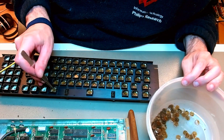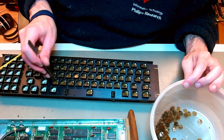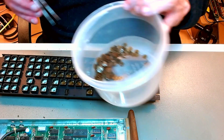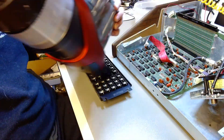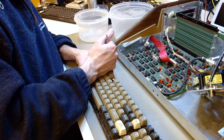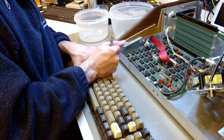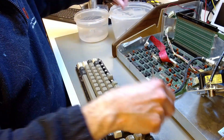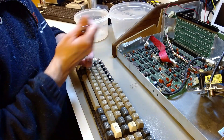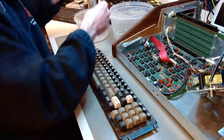So I go one by one with a pair of tweezers, removing every bottom pad after having removed the top, and then I'm going to clean off whatever detritus is left behind. I do that with a little portable vacuum cleaner on both the bottom and top of the keyboard. And now it's time to pull out the keycaps with the keycap puller. One by one — there are two parts: there is the keycap itself and there is a metal spring. I separate them in two buckets to clean them separately. I have to do that for all 85 keycaps and corresponding springs.